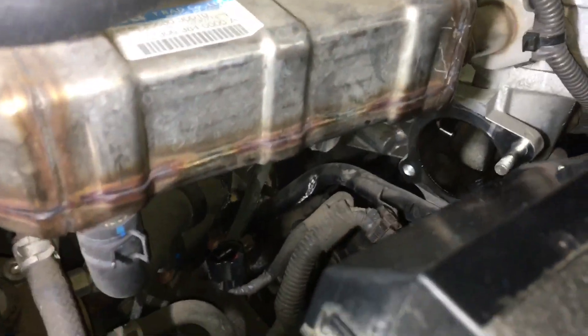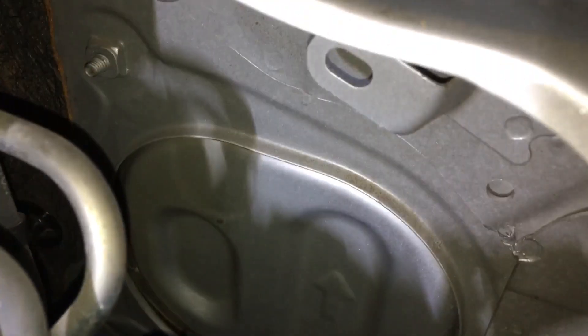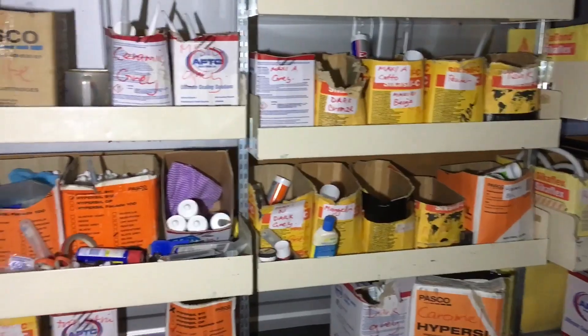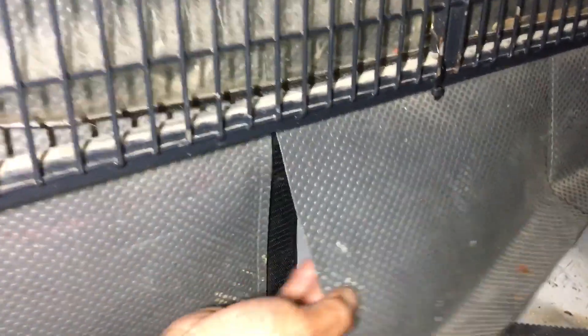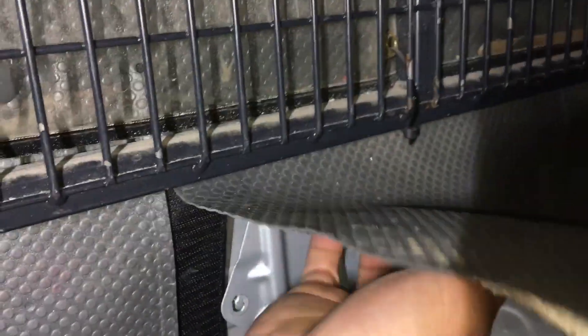This is an important one. On this engine, like the Prado and the Hilux, the oil filter is in the same place but you can't see it — it's hiding down there. The oil cooler is different and very hard to access. You could probably reach around the back, but see that panel there? That's what it's there for. Let's go around the other side and unbolt that. This van's set up nice and neat. Let's just get access to that panel — but we can't get to it because the cargo barrier is in the way.